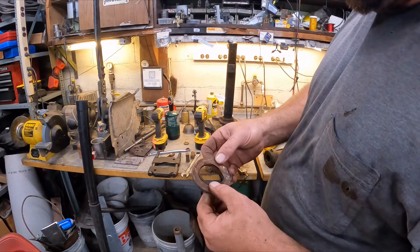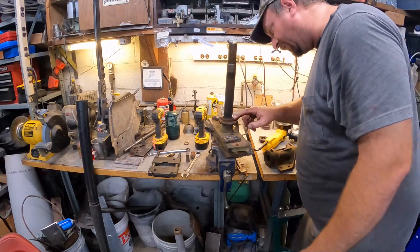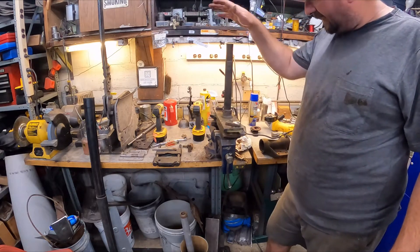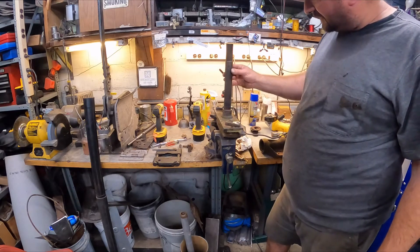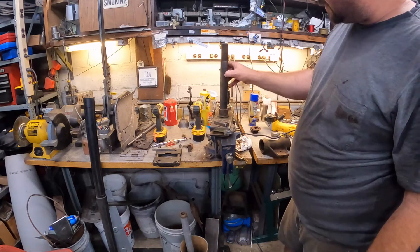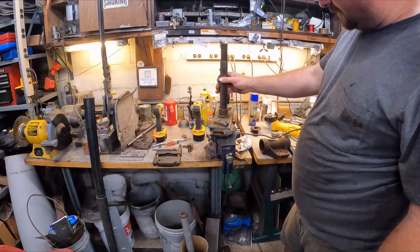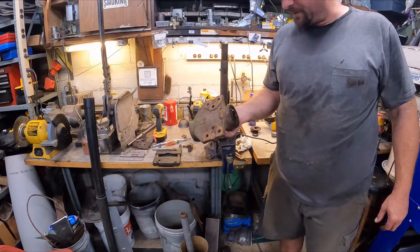This is the original seal and it's in really bad shape. Also looking at the seal surface, it doesn't look the greatest either. I got the spindle all cleaned up and I'm probably going to take it and sandblast or bead blast this section to clean up where the races and stuff sit. I noticed something interesting - it looks like someone did change the bearings on this at one time because there's a torch mark right where one of the bearing seats is. But that shouldn't hurt anything. Next we'll work on getting all the bearings and races out of the housing.